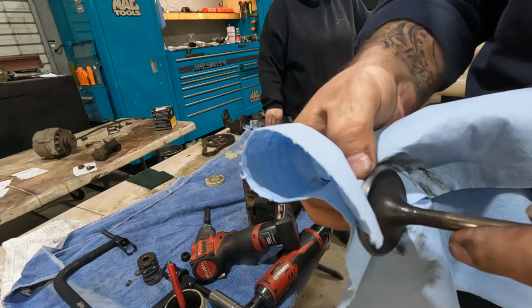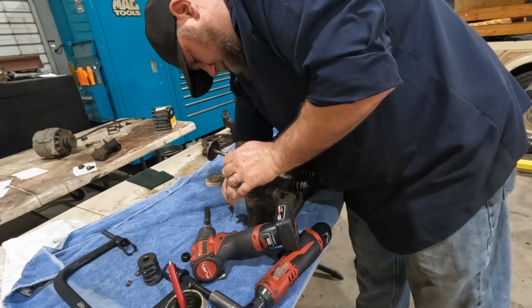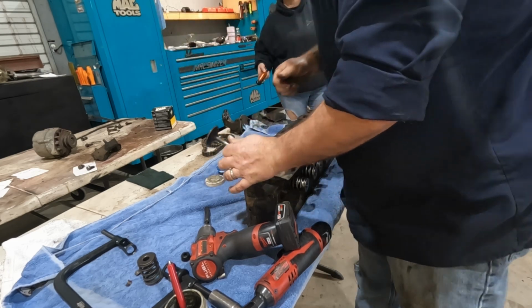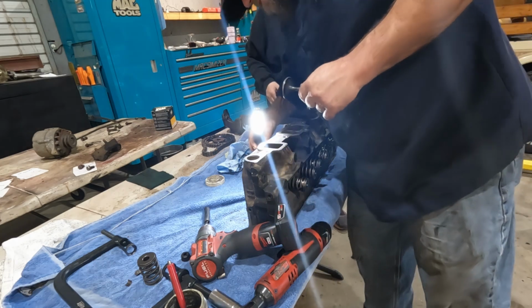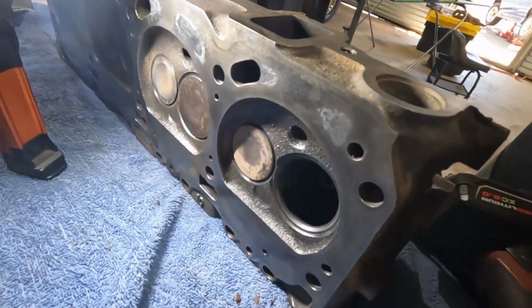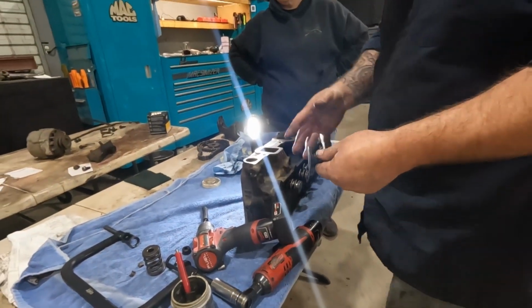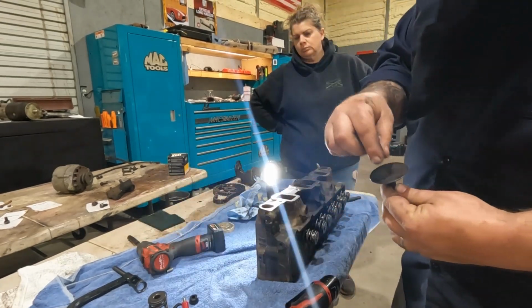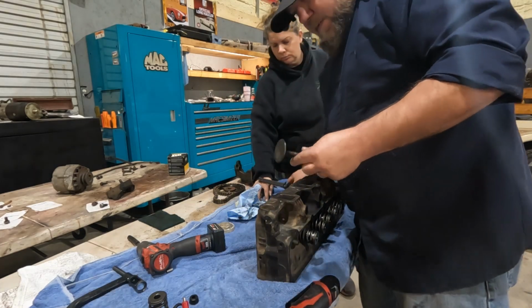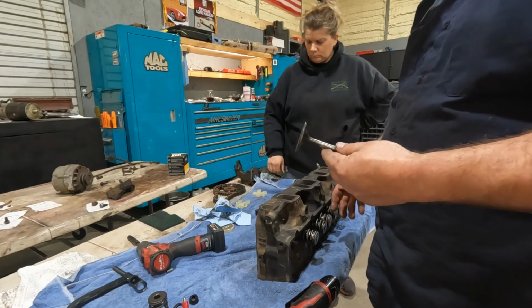See, our valve has a nice, clean, shiny line there now. Wipe this off. Get a light. Then our valve seat has that same shiny sealing surface. That's basically it. Kind of rudimentary tools. They make actual tools that suction cup onto the back and all that, but this seems to work faster and easier. So we're going to slam this back in. We got new valve seals, of course. Put the spring back on and then do it 15 more times.